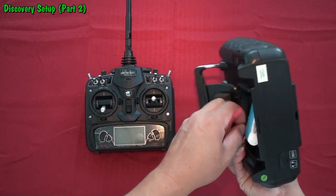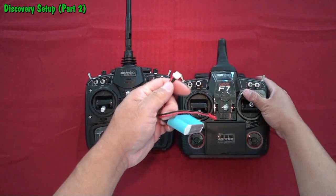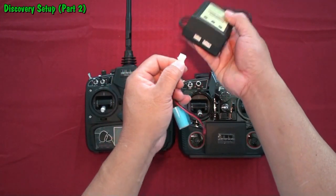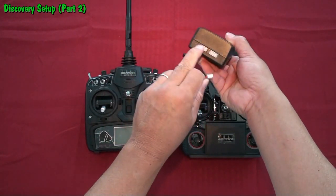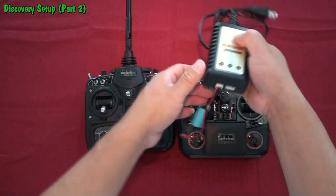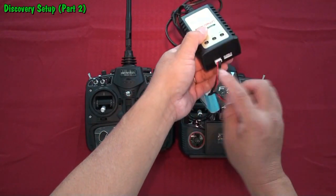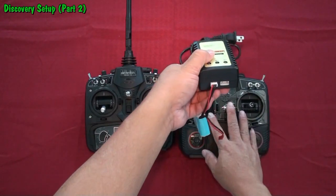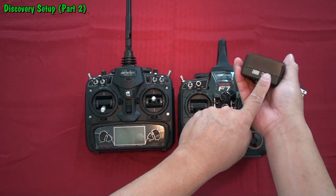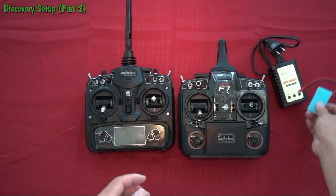Before you do that, you want to charge your battery packs with the same charger supplied in the package. This charger connects on the smaller portion of the opening and then plugs into the AC outlet. Do not charge both batteries at the same time — you'll burn the charger. Only charge one battery at a time. If you have the FPV controller, initially charge the controller battery first, then afterward charge the battery for the quadcopter. Again, no two batteries can be charged at the same time.